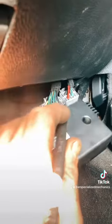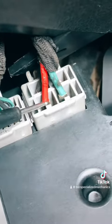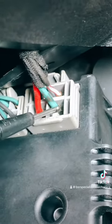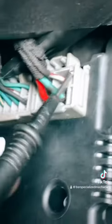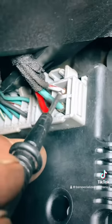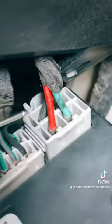We're going to focus on the right side of the connector. Going over our wires: black wire is our ground, red wire is constant 12-volt power, green solid is your brake wire — when you hit your brake or your brake control gain dial, we get power sent through this green back to our trailer. Pink with a green line is run/start relay. So with ignition off, we should have no power on our pink, nothing on our green, constant 12 volts on our red, and ground on our black.